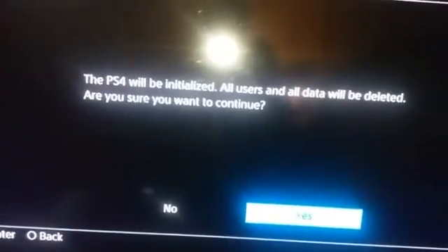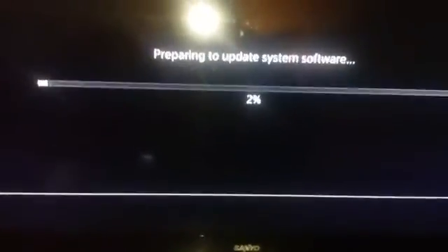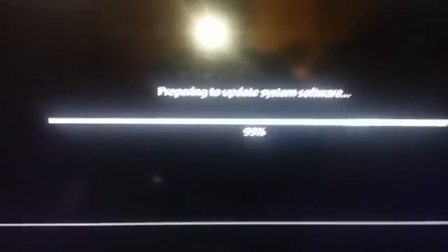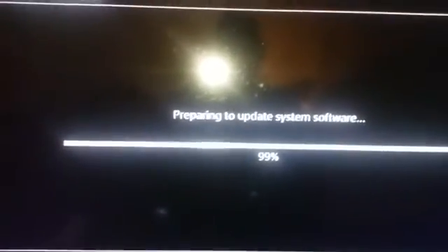Click it — it's going to say 'Connect the USB storage that contains an update for reinstallation for version whatever version your PS4 is on.' Then click OK. Note that even if you download a previous version of the software, you cannot use it because of the firmware binary. Click OK, wait — it's going to say 'Please wait,' then it's going to check for the update, format the PS4, and then update the system software. You'll be happy and dandy.